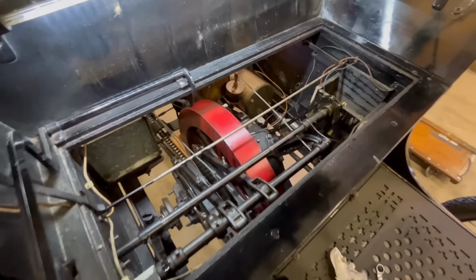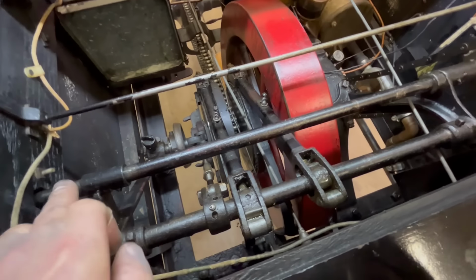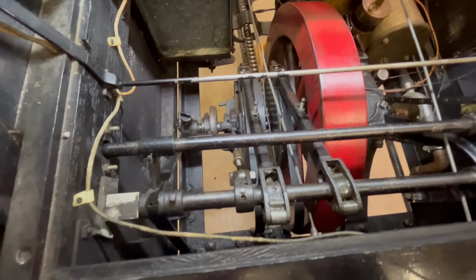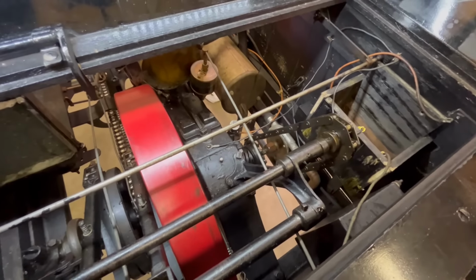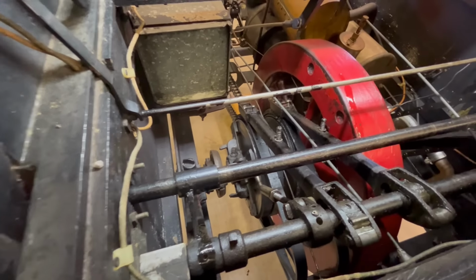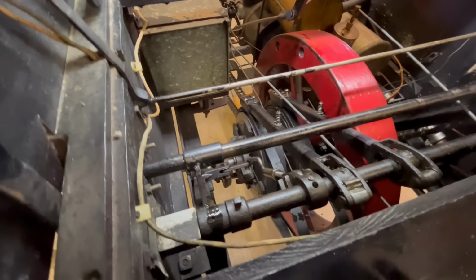All right, so I'm back up front. There's a lot more places I need to oil. One thing I need to oil is this chain. Got an oil point here, here, all over in here. And let's see, that's just on the shifting mechanisms. And the crank mechanism. This is how you crank the car over. Anyhow, before I get too carried away here. I got carried away. And I've got the compression release open, so you're not going to hear any compression.